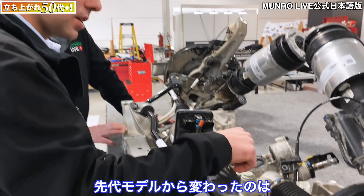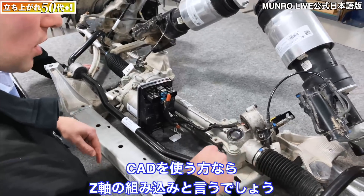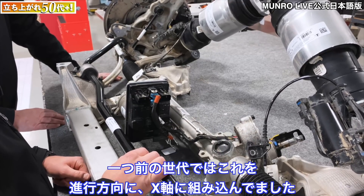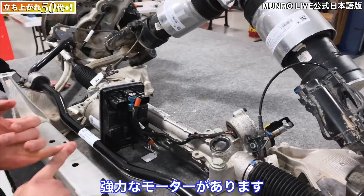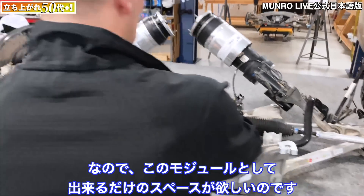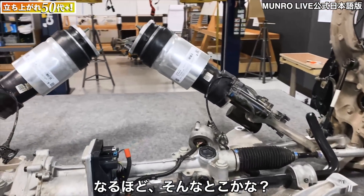What did change from the last Model S to this one is the bolt installation axis. Right now these are top-down — in CAD terms, a Z-axis installation. On the last generation they put those bolts fore-aft in the X direction. What that gives you is additional packaging space. We've got a beefy motor up here and a lot of thermal management, so they're getting whatever packaging efficiency they can to help this module sink down and sit in this assembly better.